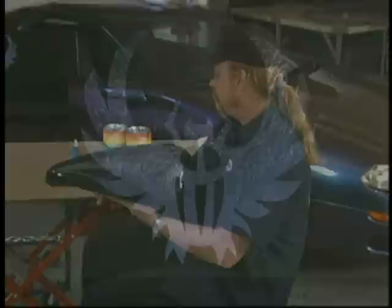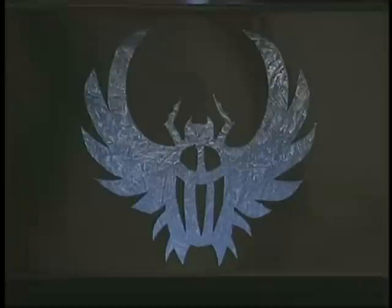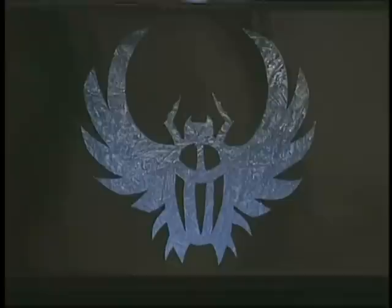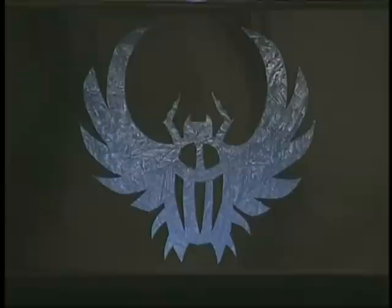After getting the flat panel back from the booth, we can see how nicely the scarab design came out after being clear coated. Now this is the exact same Kameleon that was sprayed on the Camaro as well as the flame tank. The difference being the Kameleon was sprayed over the marbleizer unlike the BC25 black for the rest of the other two projects. This gave it a much higher incidence of refraction, much brighter image. Almost looks as if the Kameleon was sprayed right over tinfoil.